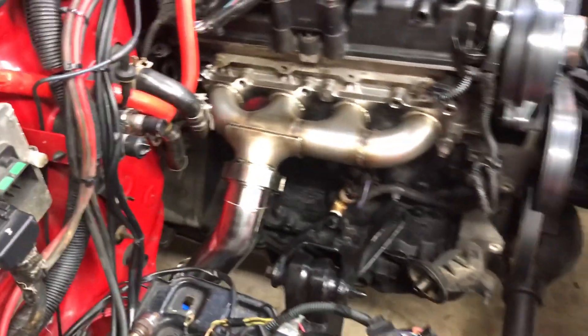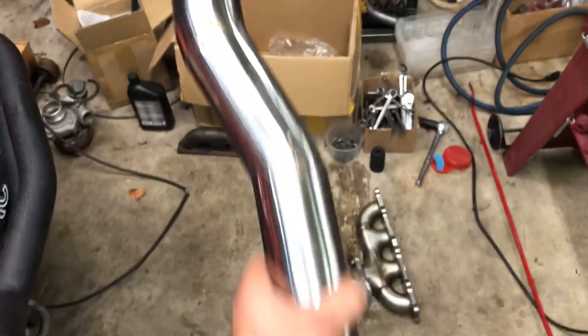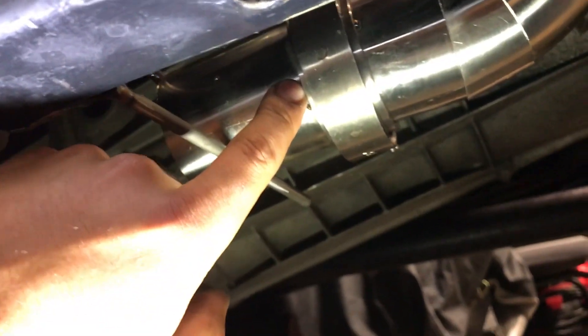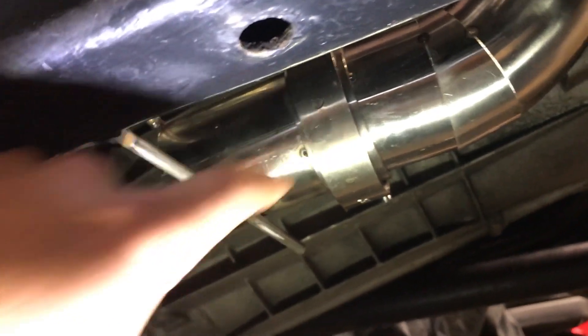I also have a jig for each one. Because I've built those turbo setups with the turbo manifold, the downpipe that comes off the turbo is actually this downpipe here. I took the turbo kit, put it on, and ran it under the Jeep to where it stops, then made a jig off the frame — basically a big C-clamp clamped to a piece of steel with a V-band on it. So both the naturally aspirated and the turbo downpipes meet up to the same spot. I also have mid-pipes that I sell that go back and dump before the rear axle, and they'll fit both systems.